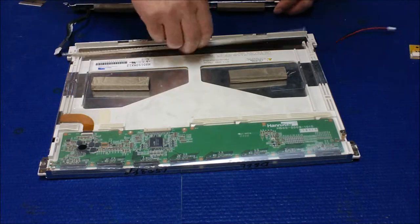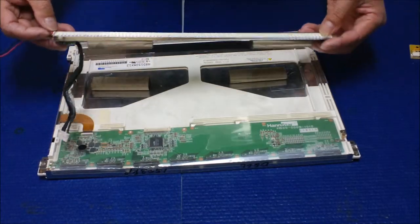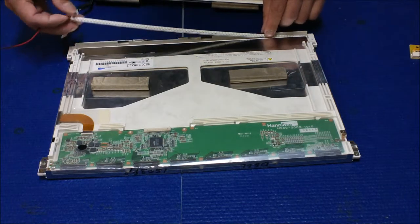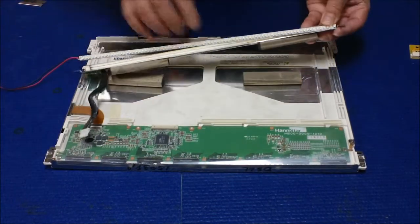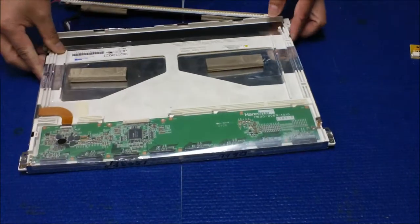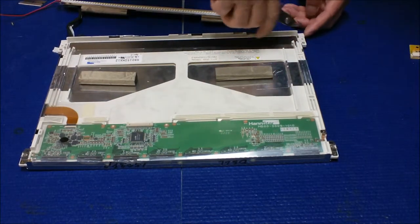What we're going to do is mount the LED inside the reflector. It looks a little bit long for this case, so we'll use a blade here. Because it's a little bit longer than the reflector on this side, and this side is plastic, we're going to open up this plastic a little bit — just a couple of millimeters — and make it fit. We don't need this plastic anyway, so just cut it off.